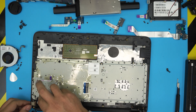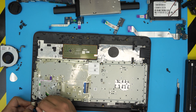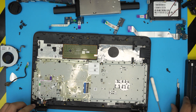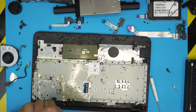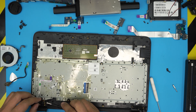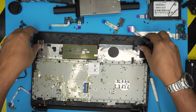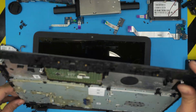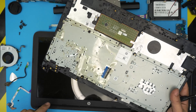Open the hinge and remove the power jack — there's a tiny hook, just unhook it. Remove the on/off switch with its single screw and lift it up. Now grab the palm rest, scoop it out, and remove it. There's nothing else remaining that needs to be removed.